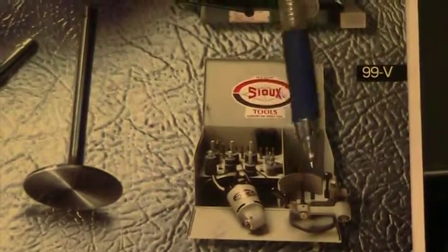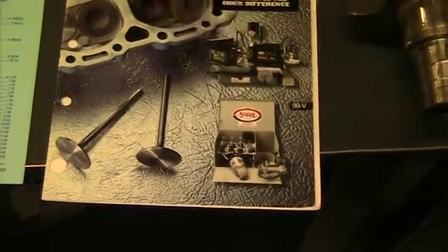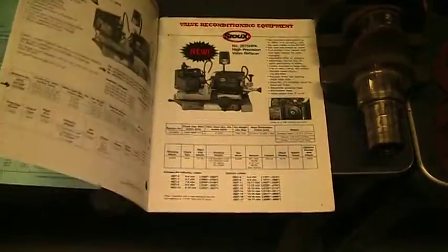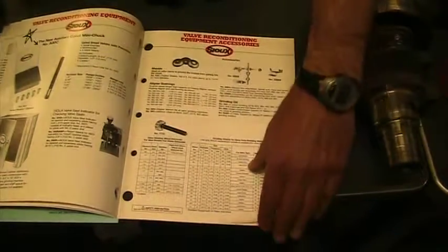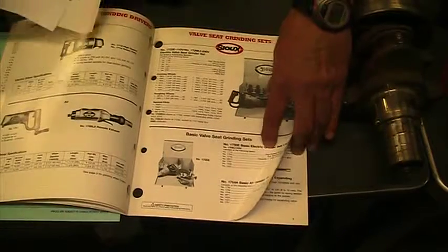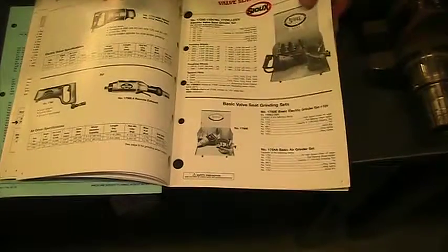You have to actually machine the stones, keep them flat all the time, kind of dress them all the time, and then you have lots and lots of stones. So our cabinet, when you open it up, it has rows of stones, and the stones come in various sizes, shapes, and actual material. So you have all these different tools. These are the tools that you use to run the stone in and out. This tool down here is what we dress the stone with.